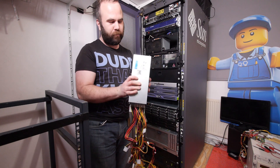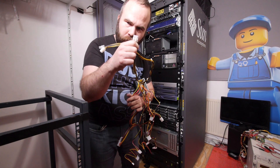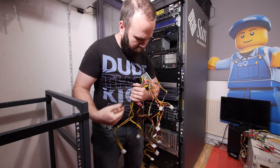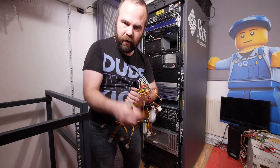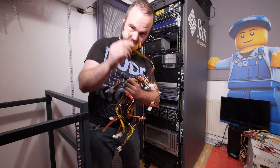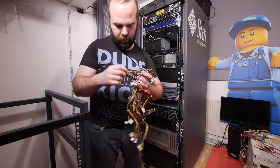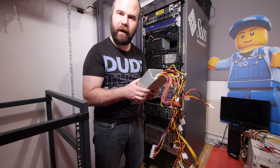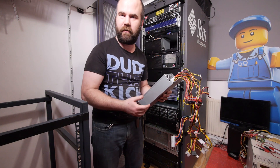So let's hope it's a good power supply. We have a 24-pin, two 8-pins because I have a dual CPU motherboard, two SATA connectors for the SSDs, and multiple molex connectors — including a floppy molex. This power supply has the perfect cable layout for my server; I don't need any splitters.